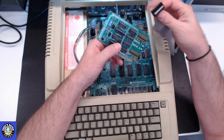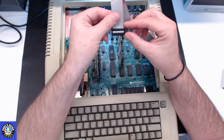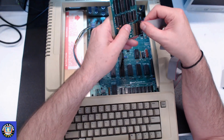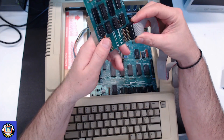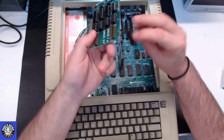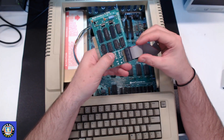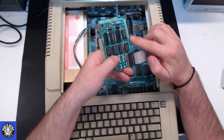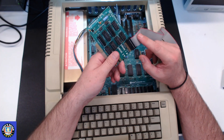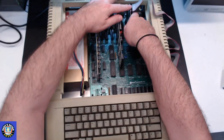Please note that on the cable there is a red line — this red line indicates pin 1, the positive side. You want to ensure that pin 1 is lined up properly with your card. It must not be plugged in the wrong way, off-centered, or misaligned. The red line on my cable is facing towards the front of the card, so it's in correctly. If you plug it in the wrong way, you will definitely damage your floppy drive, regardless of which drive you use.